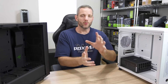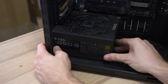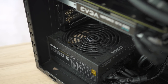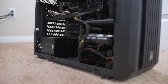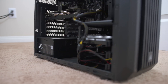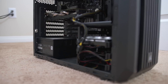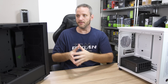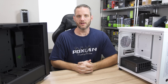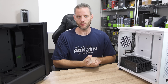The first reason: I'm going to reference my friend's build from my last video. The reason I mounted it fan-up was that he tends to put his computer on carpet. He has a nice thick plush carpet, and with a heavy computer, it squishes down and the intake starts to get choked off. He could have gotten a piece of wood or even an Ikea shelf piece underneath it to keep the carpet from being a factor. Since it was a surprise build and I knew that situation existed, I went ahead and accounted for it.